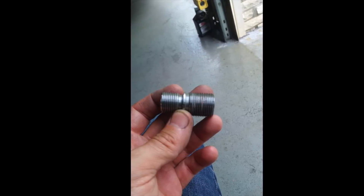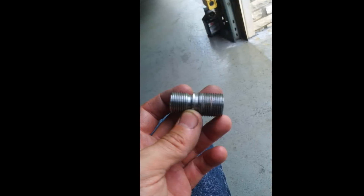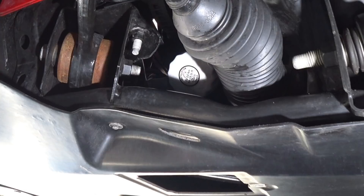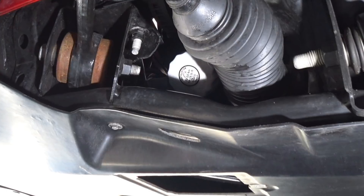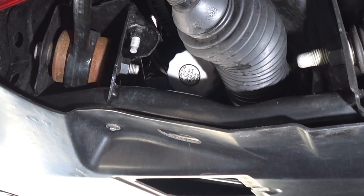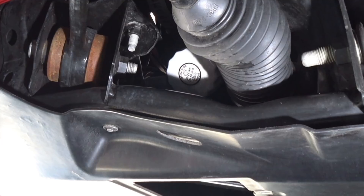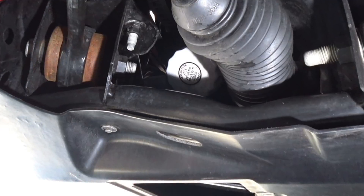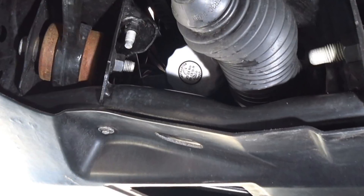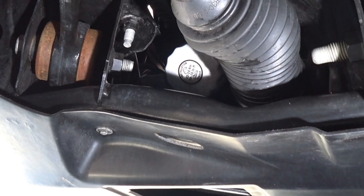It took me hours and hours to sort this out because I didn't want to break anything. If I could come across the technician that caused this headache I think I would hit him with my car — this was an absolute nightmare. This must be a reason why Ford changed the design, because I can only imagine the warranty claims they must have been getting over and over again. If you run into a seized oil filter, pick up the right tools, have some patience, get the filter cut off as best you can, and try to remove it from the retaining stud at the center of the oil pump.